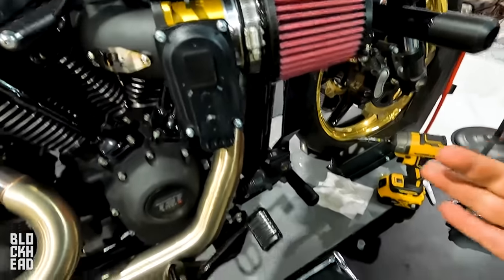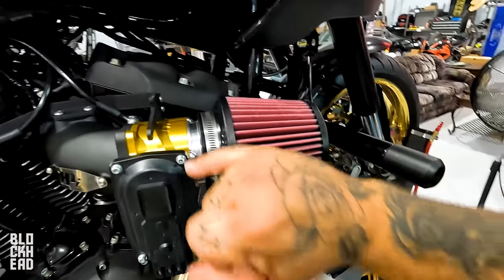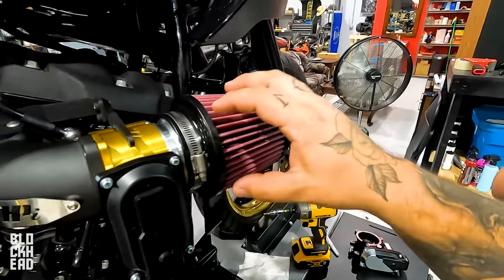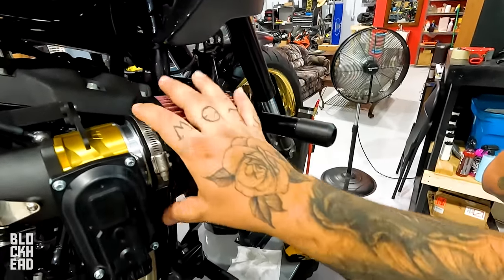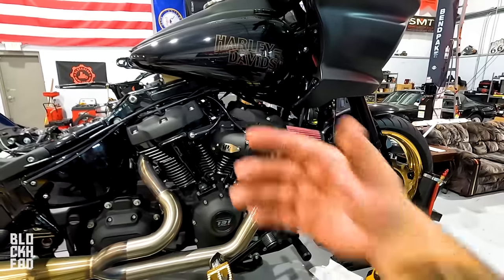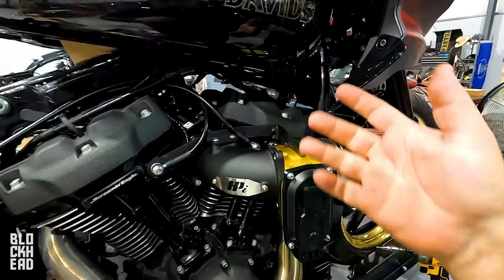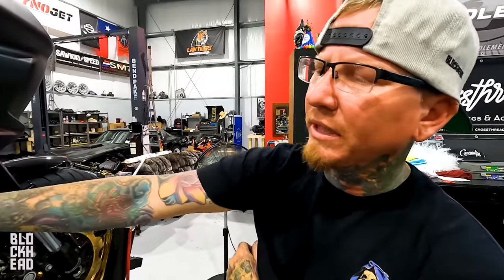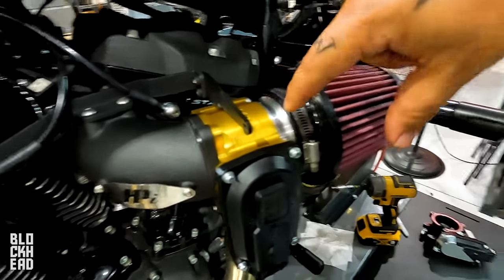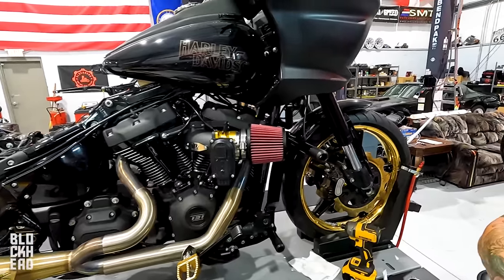Also, on the collar that joins the front side of the throttle body — it bevels in and then goes out to fit the filter. When you put the screws in there you can use a ball allen, but you risk scratching the collar because there's no direct line of sight to get a tool in there. You basically need a really skinny allen. It could easily be improved if there was a small relief cut where the screw locations are — wide enough to still seal between the collar and the filter element, but with more room for the screws to avoid marring it.